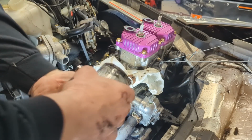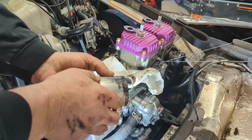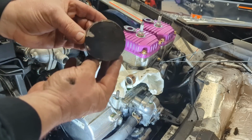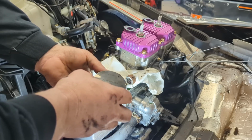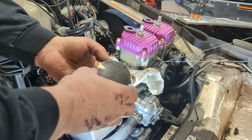Carnage. Yep, it seems like the top ring left the chat. I'm guessing that went right out the exhaust. Yeah, carnage. We might not have had the jetting correct on this one. I don't know, we ran it for 2 years though. That's the thing, we jetted it when it was really cold out, and that's where the jetting wanted to be. Otherwise, it was just a turd. And all of a sudden, that's not where it wants to be.